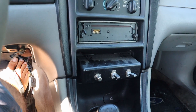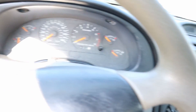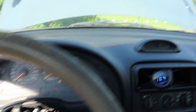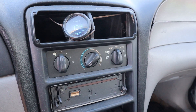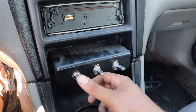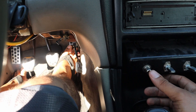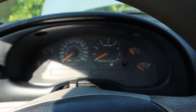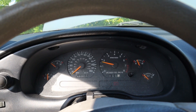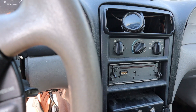Put the key in the ignition. When I turn the key on you hear that beeping — okay, beeping has stopped. I have an aftermarket temp gauge in the bottom radiator hose. The switches are: one for the fuel, one for the distributor and fan, and one to start it. Because there's no choke, it doesn't start right away — I give it one, two, three pumps of fuel, then crank it. She shuts off, but that's normal with no choke installed.